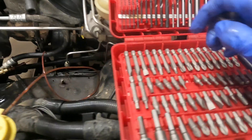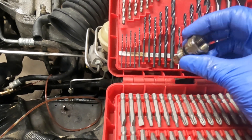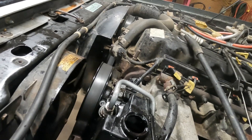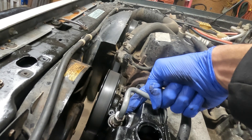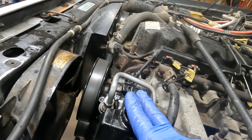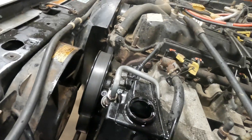If you did drill it out, I would say stick with 9/64ths - just one step up from the 1/8 inch it starts at. I didn't notice any huge difference in steering effort as I increased the volume hole size. So I think: take a stock TJ pump, put the WJ pressure relief valve in there, and send it. It seems to make a big difference and it has the same steering effort as a WJ pump - way easier than putting on a WJ pump.